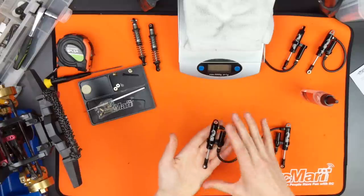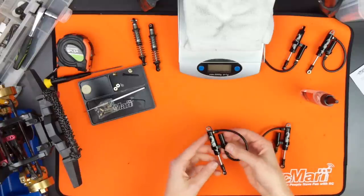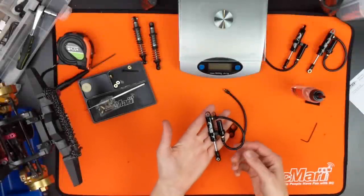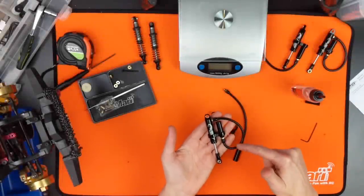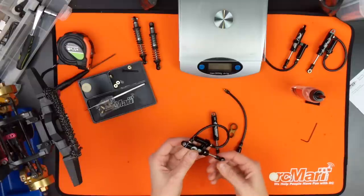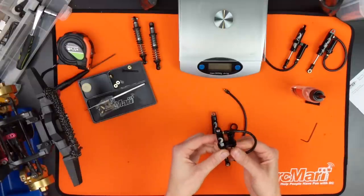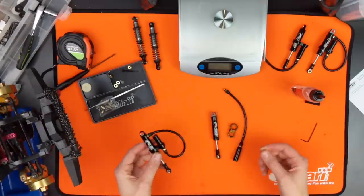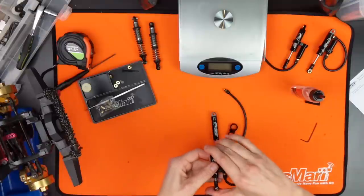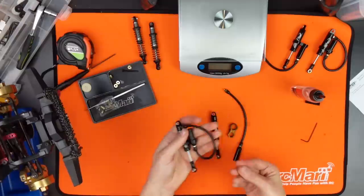These also seem really, really smooth. If anything, they might seem a little bit too stiff, so we're going to have to try them out on the trail definitely. How I set these up is I tried to get the least amount of air throughout the entire system. Ideally you'd want to be able to bleed the air out, but the way it's designed you can't really get all the air out completely, unfortunately. I'll show you guys what I did to get most of the air out — I feel like this is a really nice and solid setup.